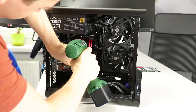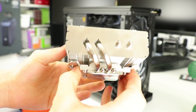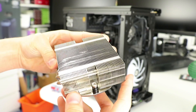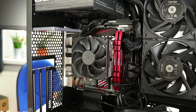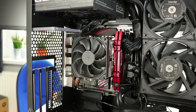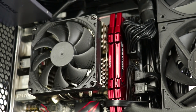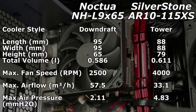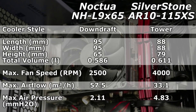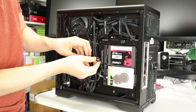After all testing was complete with the Silverstone AR-10-115XS tower cooler, I changed over to the Noctua NH-L9X65, which is a 65mm tall downdraft cooler. I've also placed my painted version of the A9X14 fan on the L9X65, which still performs as well as the original fan. Key differences between the two coolers — the style, the size, and the airflow rates — can be found on screen now. At this point you probably want to move on to results.